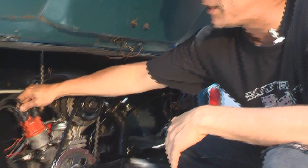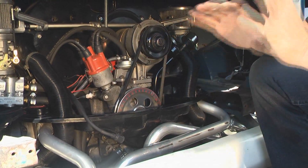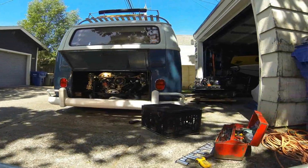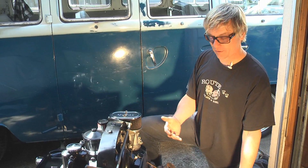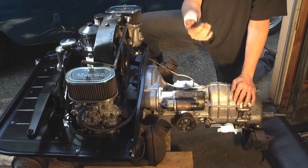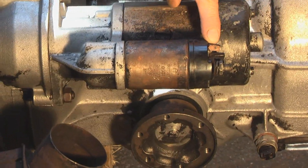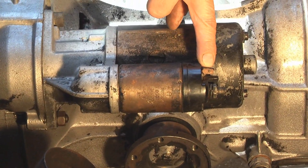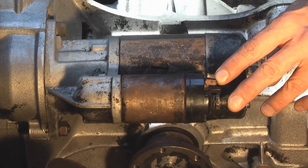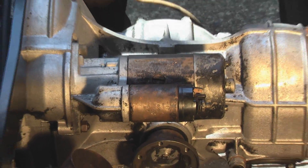The first thing you want to do is disconnect the coil wire — make sure the motor is not going to start up and just start running, because again we want to make sure we build oil pressure and fuel pressure. So we took off the coil wire. Now just hit the remote starting button. Here we are at the 912 motor as a learning tool — back here at the transmission area, the starter in particular. I wanted to show you where you hook your remote starting switch up. This is the positive that connects to the battery on your starter, and then this is your starter solenoid, or ignition switch, that you're turning on to engage the starter. You just connect a pole to each one of these on the car, and then your remote starter switch creates a circuit which provides 12-volt spark to the solenoid, which then turns the motor over.